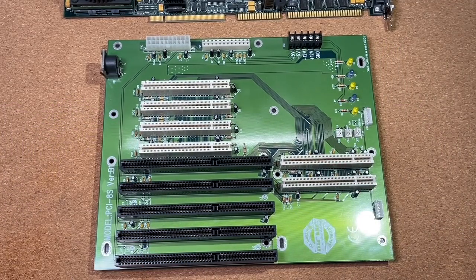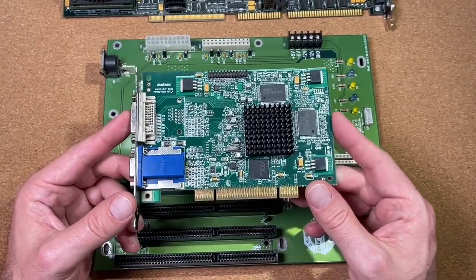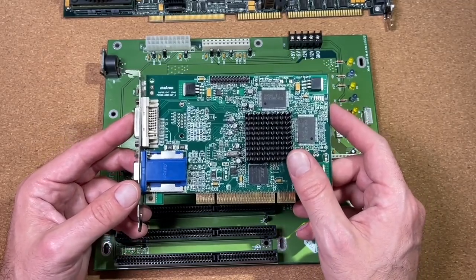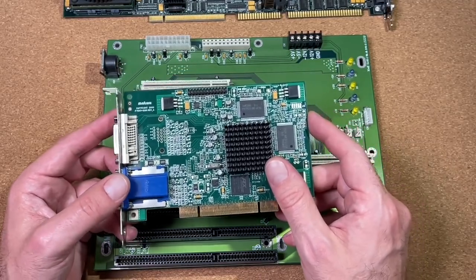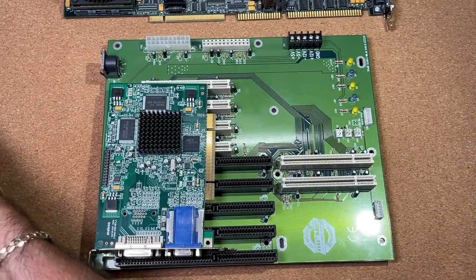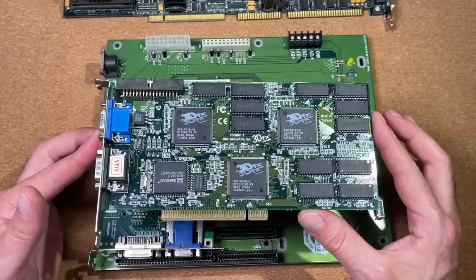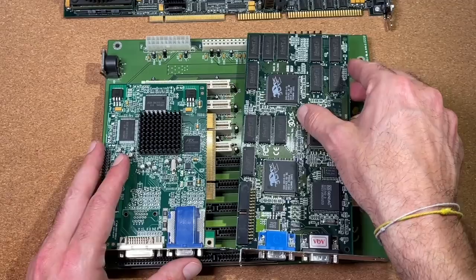For the video card, I will take the Matrox G450. It comes with 32 megabytes of video memory and a perfect 2D image quality. The 3D capabilities are also not that bad on this setup, and for sure the CPU would be the bottleneck at the end. But to make this setup a little bit cooler, I will use a 12 megabyte 3DFX Voodoo 2 for 3D gaming. Here also the limiting factor will be the CPU.